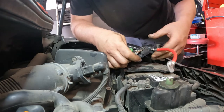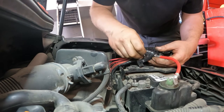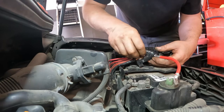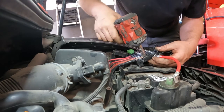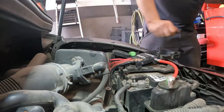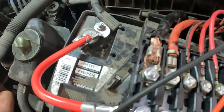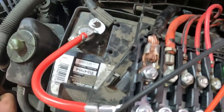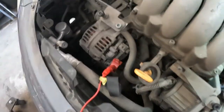Let's see what kind of voltage drop we get and what kind of heat we get off that. Keep in mind, the battery is pretty low right now, so this will be asking a lot of the alternator. It's not the nicest looking crimp — there's a couple wires sticking up — but there's a lot underneath there and the copper's cleaned up a fair amount. We got our nut on there, nice and tight. Main cable's on. We got the lead on the main positive of the alternator coming all the way around to our multimeter.